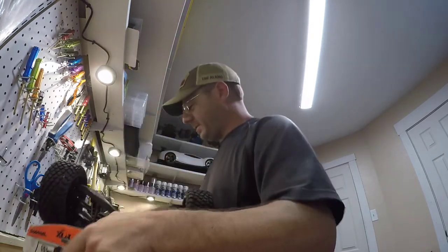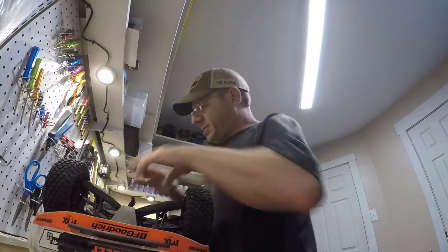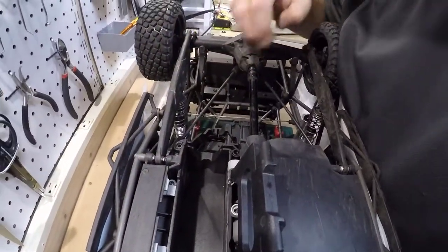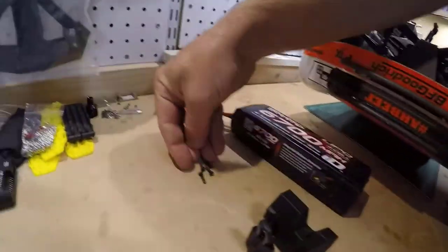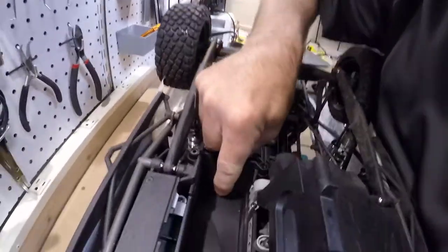Now in its stock form, this is what the battery compartment looks like, and here is the stock end plate. This is what I was judging the depth of the battery compartment against. What I didn't notice was that extra piece in there. So what happens is you take these four little bolts right here — four little bolts that come out — and this little piece comes out. It needs a little bit of prying, there we go. That slides out, and you can just set this aside.